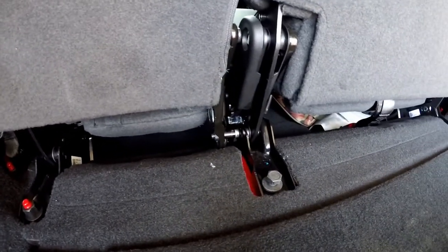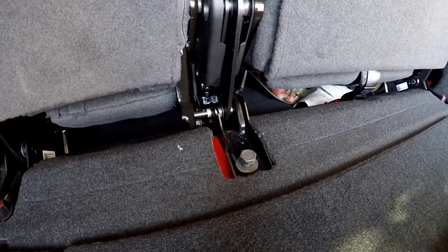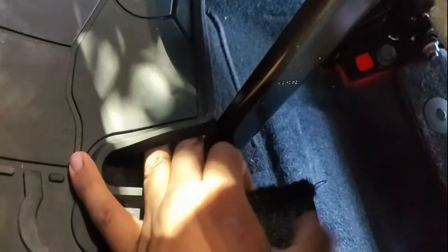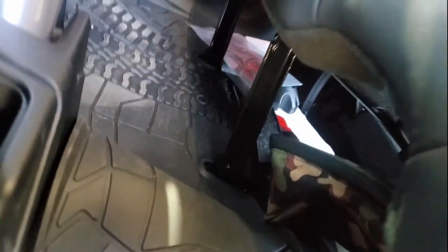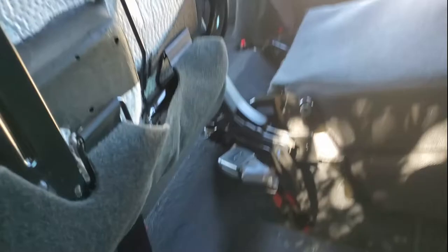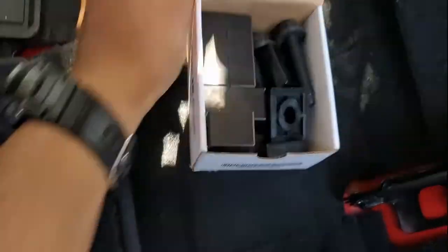For these rear bolts, you only have to remove them just a little bit — not completely out. Just slightly unbolt them but leave them on. Moving on to the front of the seat — there are bolts right here, one right there, and one right here. We have to remove the carpet a little bit on the other side as well. After you remove those front bolts, you're gonna use your seat belt to hold and position the bottom portion of the rear seat — you guys can see it's all strapped right there.